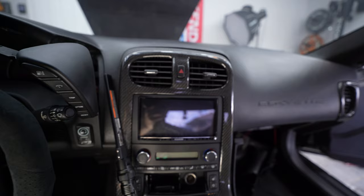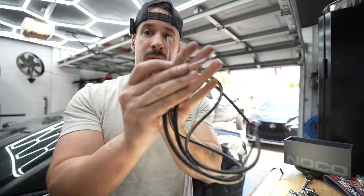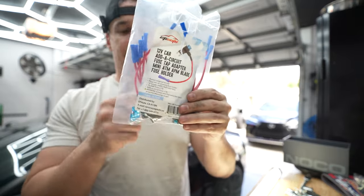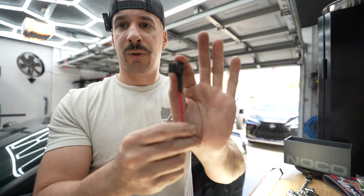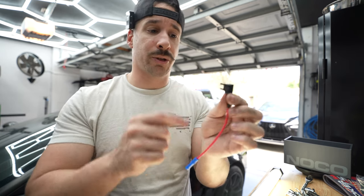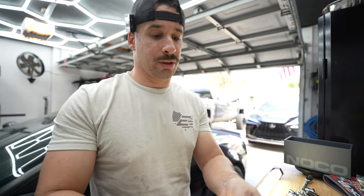I'll put the gauge pod link in the description along with the gauge and everything else. Here's the last wiring harness — red is power, black is ground. Now all these additional wires I was overwhelmed by: according to the instruction manual, those are for if you're going to have some sort of AEM management system. So we're basically just going to use the power and ground. This fuse tap adapter does not come with the kit, but I highly recommend it instead of live-tapping somewhere. It's designed to tee off on a specific fuse — we're going to use the seat heater fuse, which turns on with ignition, so a new fuse will sit side by side with the seat heater fuse.